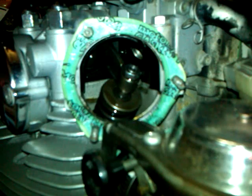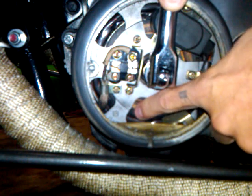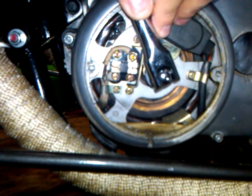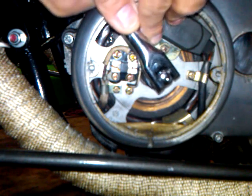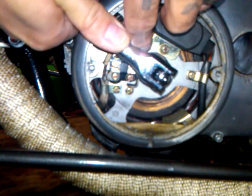We've got the bike to top dead center. I'm going to go through real fast and double check. The exhaust valve is going down and opening, then the exhaust valve is closed. So the intake valve is going down and opening. I'll wait until it comes back up, then stop and look at my rotor. I'm looking for the timing marks on the rotor — I want to finesse it over to the right side of the T where the timing mark is. You always want to put it in the same spot, and there it is.